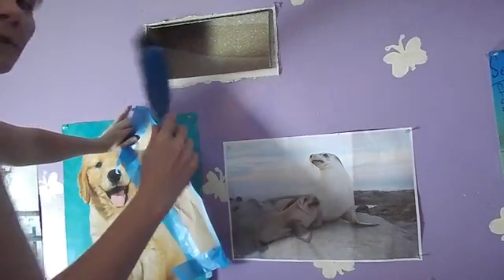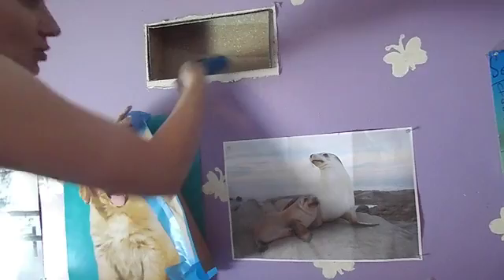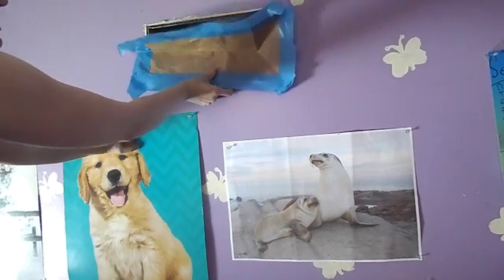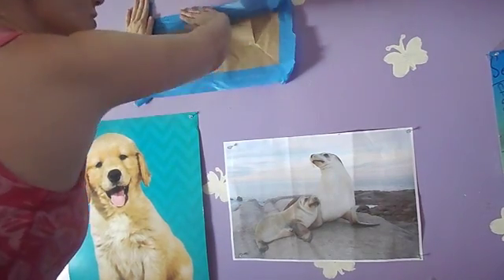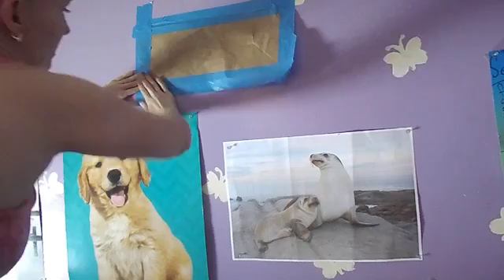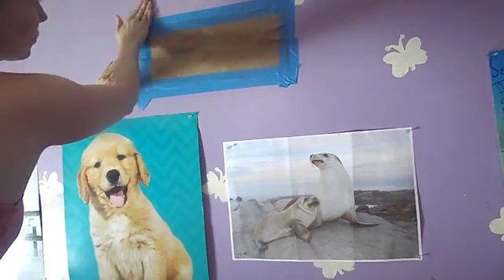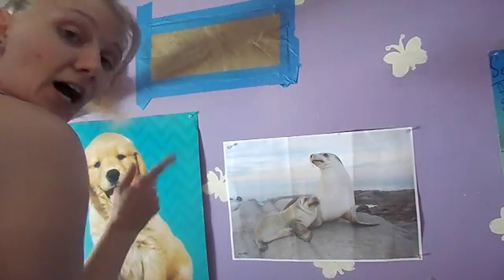I got it all cleaned up there. Just took a little brush — you get in there as much as you can. Brush away what you can. I also stick my vacuum cleaner hose in there a bit, but most of this is going to settle down and we're going to vacuum it out of the main spot anyway. Here are the paper bags we had before, cut into pieces. Put on some painter's tape — it doesn't have to be anything fancy. We are going to cover up this hole for when we suck out the bottom of the unit. Try to get it relatively tight, because you don't want air getting released from there. I've already done the one on her floor — that one's pretty easy, no tape needed. I just put down the paper sack and set a book over it.